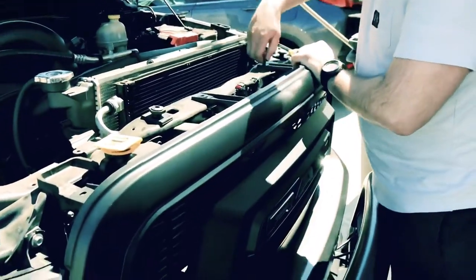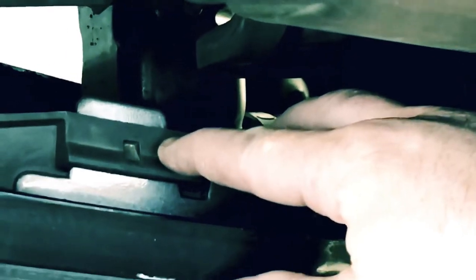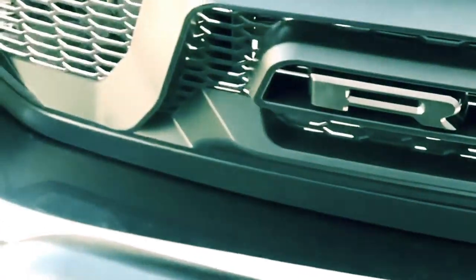I'm going to install these bolts real quick. There's a little channel down here that's a part of the bumper and it will give you a more seated look. This right here is a part of the factory bumper, and this double-sided gray side is part of the actual grill — it kind of seats inside. There are three of those: one on each side and one in the middle. If you don't get those inserted, you're going to have a really bad gap down below and it's going to look funky.